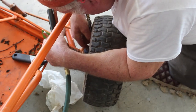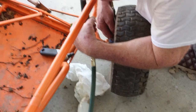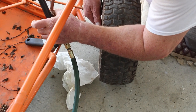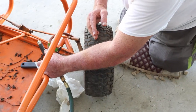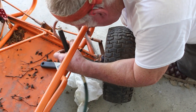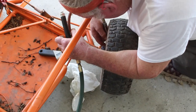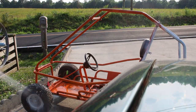How do you accidentally put this on backwards? Because it's a split rim, it comes apart. Yes. And they put the rim tucked into like this. It's got a tube in there, and they should have put this side on the outside and this side on the inside. And then they just put it on backwards. Which is crazy. No, that's the reason. Always trust your local mechanic.